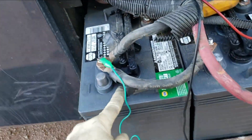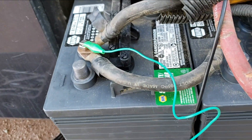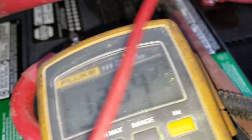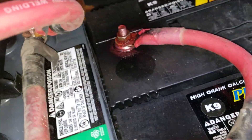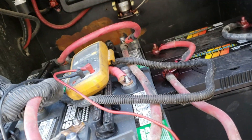With the batteries hooked up, I have my jumper on ground — chassis ground and house ground are the same. Checking battery voltage on the house side: we're at 12.50 volts. Over on the chassis side we're at 12.64 volts. Confirming on that terminal — house is at 12.5 and chassis is at 12.6. All hooked up, now we can do what we planned.